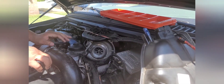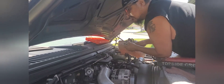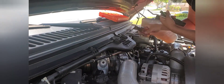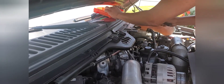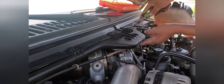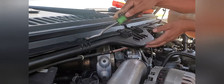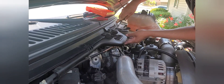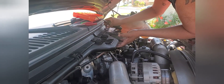I always have a tray to put your loose hardware in. Next I'm going to get this wire off — this goes to the power steps, so they routed it here. Then I'm going to take off these panel clips and put them all in the tray. Be careful not to break them — these six-liter trucks are now about 15 years old if it's a 2007, add a year for every year under 2007. These are a lot of times real brittle, so you gotta be careful you don't break the plastic.